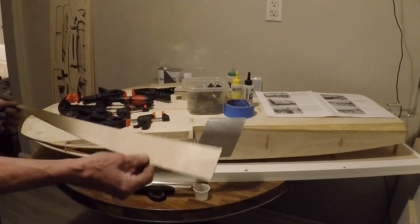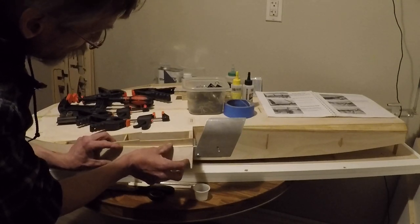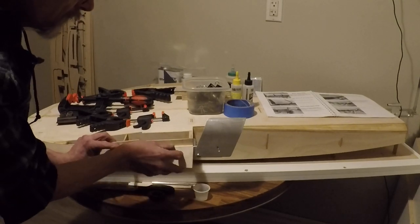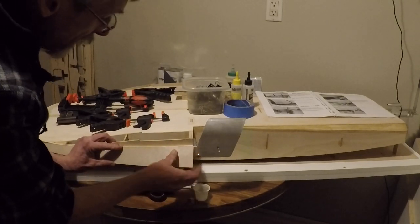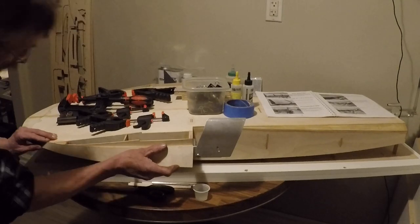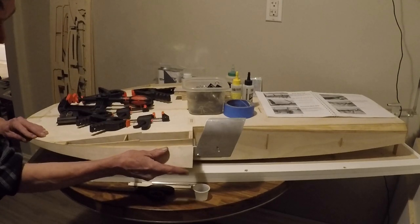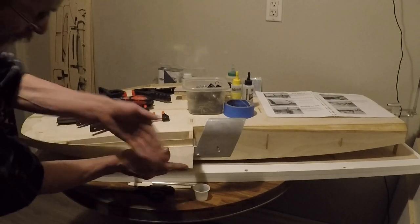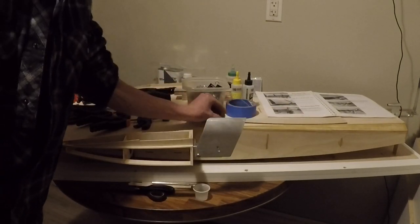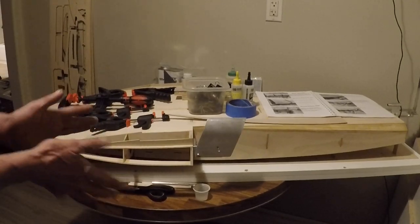You'll notice when you're installing this piece that it does have a little bit of a lip on the top and bottom — there's a little extra material there. I'm predicting we're going to have to lightly sand it off once the part is cured, so get a good flush fitment and take your time. I find it best when pre-fitting the pieces to start clamping in the rear and slowly work my way forward, gradually bringing it in. So let's mix up some epoxy and install our first forward non-trip.